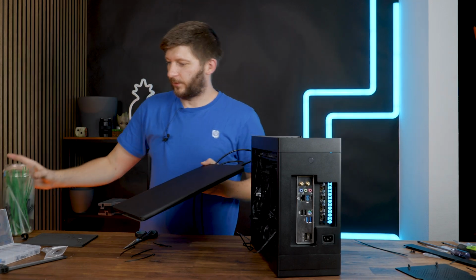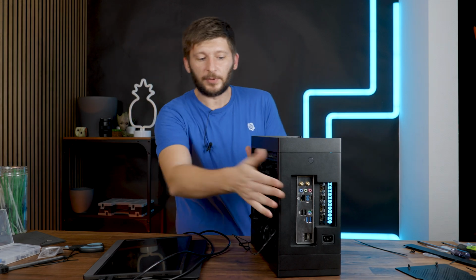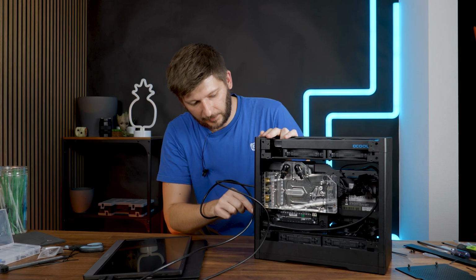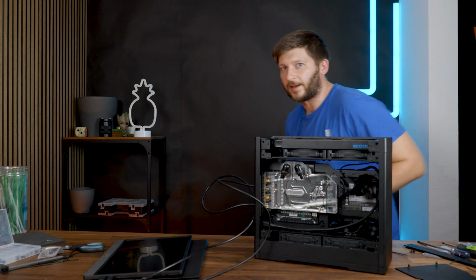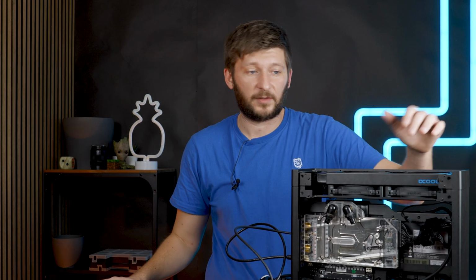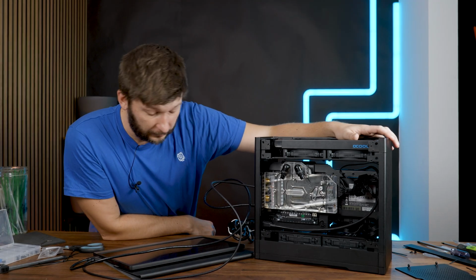The reason we are doing this is because of bad experience. So it's relatively easy. Before I proceed with filling up the loop, because that's essentially the next step, or closing off the loop more, I would like to see if the whole thing still boots. Or let's say that something went wrong with the GPU and maybe it's not working anymore. You never know what could happen. Or more, because I've seen that happen too often. That's why I will boot this thing now, because it's a 5800X and a 3070 which will boot into BIOS. So there isn't enough heat to make that thing do anything essentially. It will just be hot for a minute, but not like overheat or anything. At least not on BIOS.